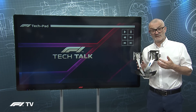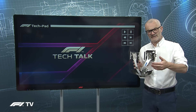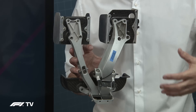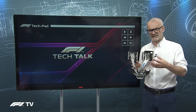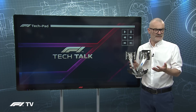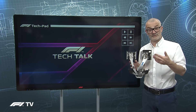Now the brake pedal — this is the one that does the heavy work. It's a very strong pedal, because when the driver is braking they're putting 130 or more kilograms of force into it. That comes partly from the driver's leg muscles but equally from the g-forces of the leg being pushed onto the pedal — it's not 130 kilograms of pure muscle, it's 130 kilograms of muscle plus the weight of that leg under 5g. That force then operates the master cylinder. On a road car you have a single master cylinder under the bonnet, but on a race car you typically have two — one for the front brakes and one for the rear.